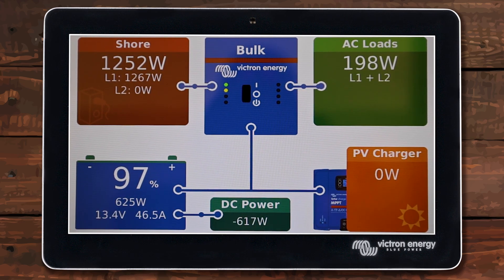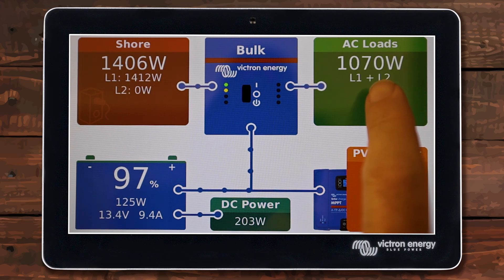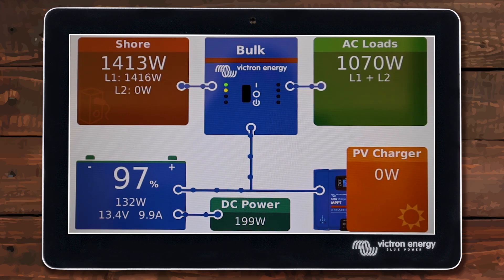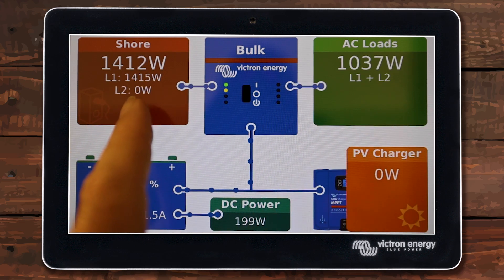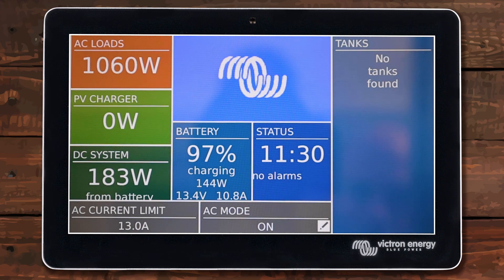We got some increase in our AC loads. It takes a little bit for the screen to catch up with what's going on with the inverter — actually it's pretty quick. You can see now we're bringing in 1400 watts from the shore and we're powering a thousand watt air conditioner. It's pretty cool outside — normally air conditioners pull between 1300 and 1500 watts or more if it's really hot, but it's only pulling a thousand watts right now. We're pulling 1400 watts from shore and only a thousand on AC loads because the remainder is going to lights, vent fans, the 12 volt fridge, and what's left over is actually going into the battery — so we're still charging and running one air conditioner on just a 13 amp outlet.